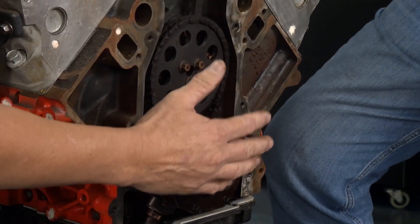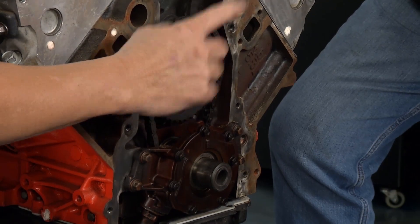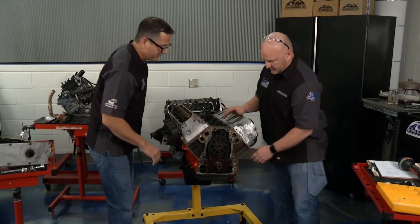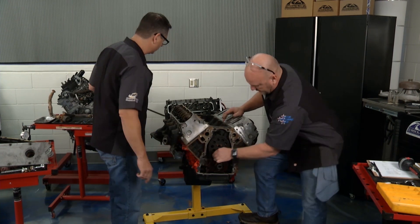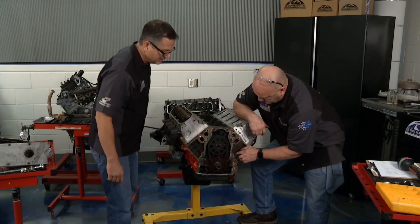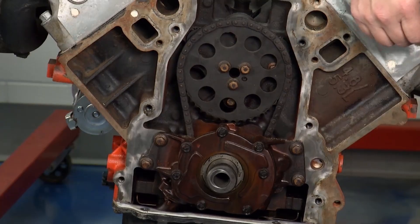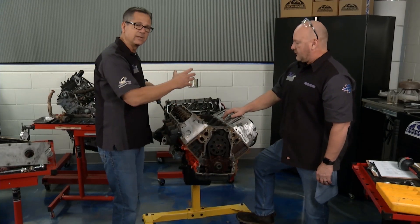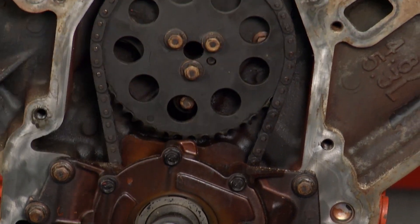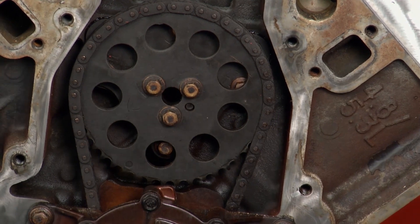These front components — you've got the oil pump here, the actual drive, the crankshaft down here, and the camshaft right there. If I get a pry bar on the crankshaft back here and you watch — I'll put it on the flywheel — you can see deflection. Tell me when we start pulling the other side so we can actually look at that stretch. We're tight on this side now. You can look at a distributor and see when it moves — that's called timing chain deflection. Or you can put a dial indicator right here and see how much stretch we have — timing chain stretch.